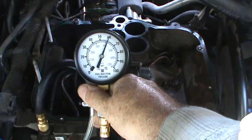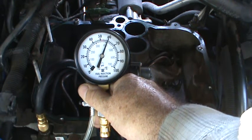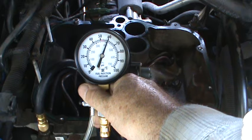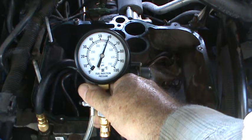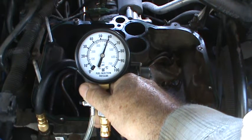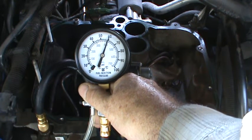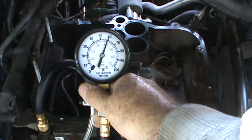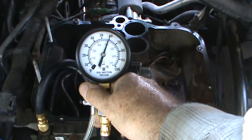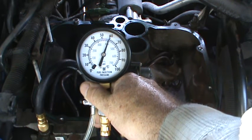I worked out some figures with the specifications, and as long as your fuel pressure when you're idling doesn't drop below 48 psi you should be good to go. The poppet nozzles require about 43 psi so that the pressure can overcome the spring applying pressure to the ball bearing at the end of the poppet. So 48 psi gives you about 5 psi above poppet opening pressure. If anyone can tell me whether the poppet actuation pressure is 43 psi or not on these engines, please feel free to leave a comment.